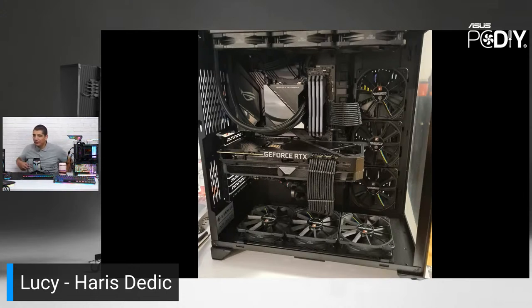In terms of the core hardware, we've got a 5900X, an X570-F gaming board, an ROG Strix RTX 3080, Ryujin 360, 32 gigabytes of memory, and only the NF-A12x25 iPPC-based fans. The iPPC-based fans are not the Chromax, but the actual industrial versions of Noctua fans. They have them in two different RPM levels. Fantastic fans, built great, very good performance. They're generally a little more static pressure optimized than airflow optimized for a chassis fan, but they definitely still get the job done. And you can't knock the Noctua quality. They're a great choice for cooling.